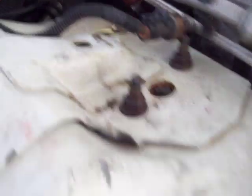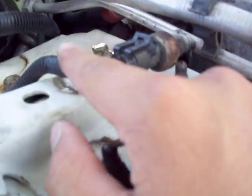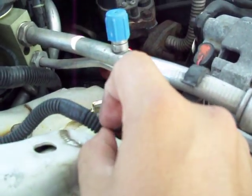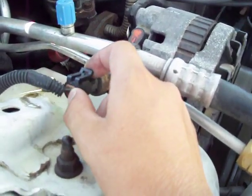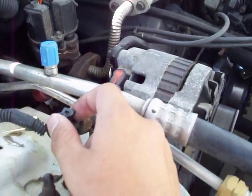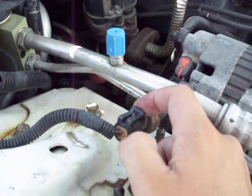The reason why this happens is because you have low pressure in your coolant. This right here is a low pressure line, and this is a high pressure line. The sensor is on the high pressure line, and if you have a two wire sensor you can go ahead and short that out, and that will make your clutch automatically engage. If you have a three wire sensor you can't do that. The reason you can't short this out is because it senses between 0 and 450 pounds, and if you short it out the computer will think it has 450 pounds. That will make your drive train do all kinds of wacky things. So if it has two wires you can short it out — three wires, stay away from it.